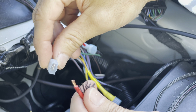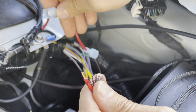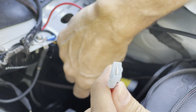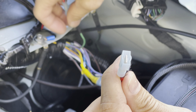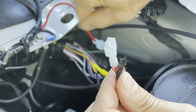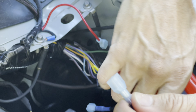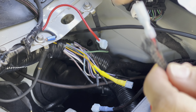What I like to do to make this a little bit easier is add the male connectors. All of my wiring that comes out for the auxiliary switches I usually go ahead and put the female connectors on the end so I can plug and play a little bit easier, because I do change things out pretty often. So for the fog lights I'm going to put one of these adapters on both of them so I can just plug them in. The yellow wire is 30 amp, the green wire is 15 amp, and the other wires that come out are all 10 amp. So we'll go ahead and attach these and then plug them in. I'll just clean this up, run some tape around it, and we'll be good to go.